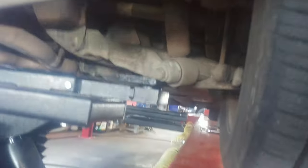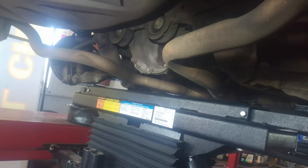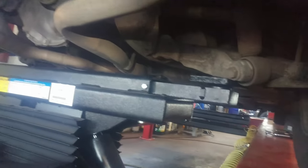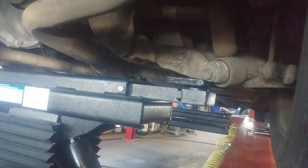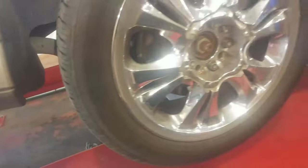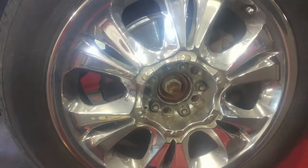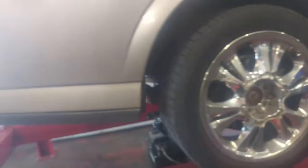There's pretty good metal underneath here to jack up on. You'll probably jack up on the rear differential, center the pumpkin, then lift the vehicle up to get both sides off the ground. Use safety stands to protect yourself. Before you jack it up, break the bolts loose a turn or two, then go ahead and jack it up and get the tire off the rest of the way.